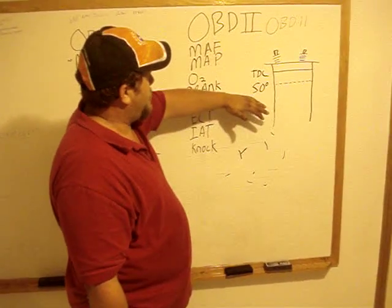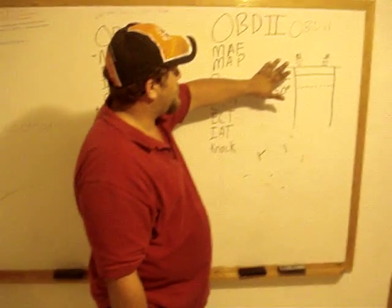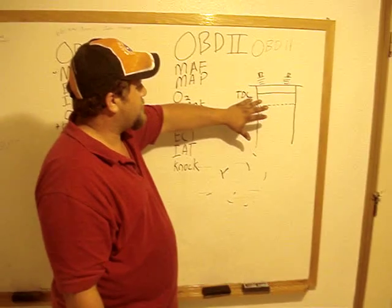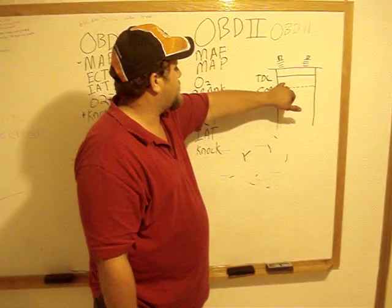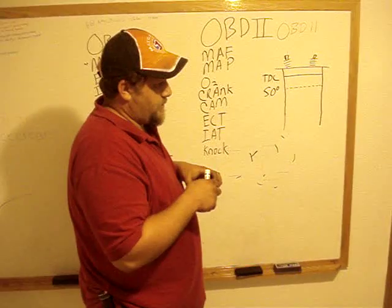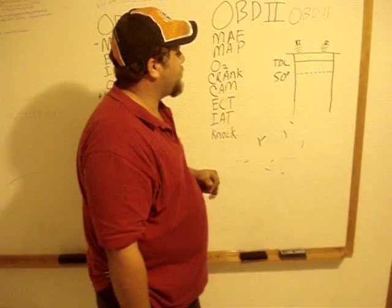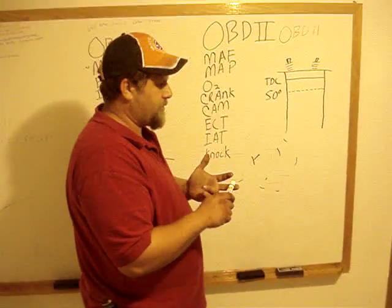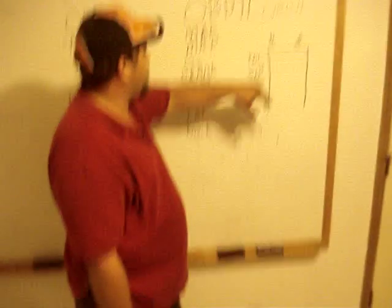The HHO we know lights way faster. On some of the cars that are getting better fuel mileage, every cylinder head has a different design, and some designs actually work better than others. On your faster burning heads they're more efficient. But a lot of the positive numbers I'm seeing are actually from the more inefficient heads. Introducing HHO prior to top dead center is more or less vaporizing that fuel and letting the vapors peel off to where it's used in the power stroke — so actually the more poor-design engines are benefiting from it. Our fast burn chambers like newer Chevrolets and newer Chryslers — and actually Honda doesn't have that great of flame speed — so they're seeing some positives. This is coming from a performance engine builder and this is what I'm seeing in my head going on.